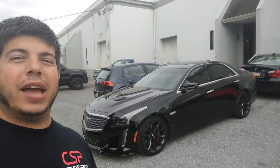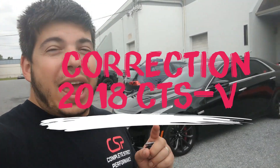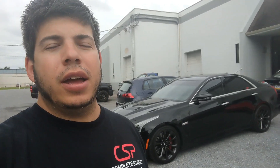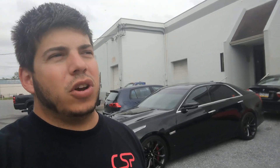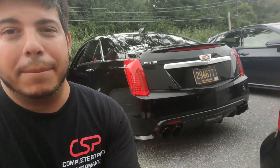What we're going to do now is we're going to take this fancy 2016 CTS-V and do some tests on it. We're going to add a rotofab intake and then headers. But first we need to baseline it. To keep tests consistent, we'll put it on the dyno tonight, let it warm up to operating temperature tomorrow morning, and run it. That way, heat soak is not really a factor. This car is stock minus a Corsa.